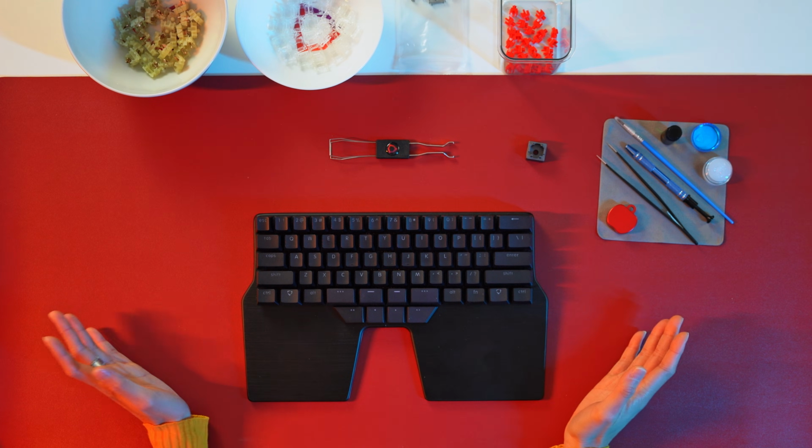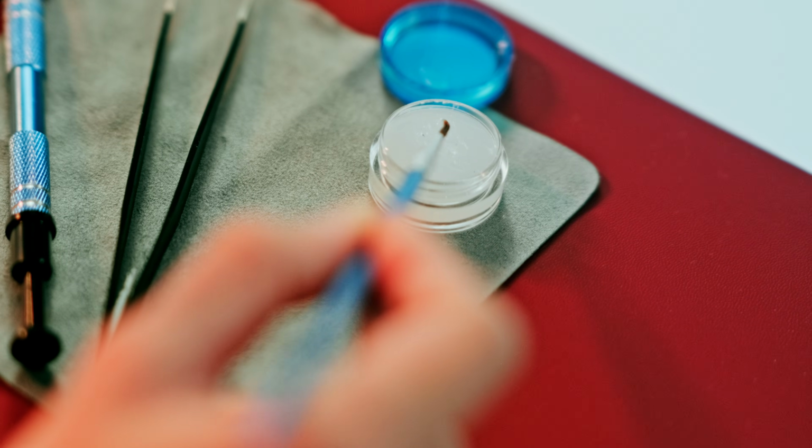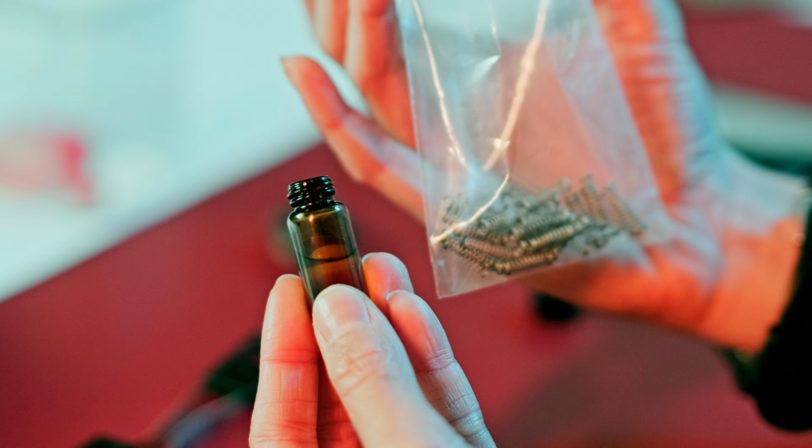First, you have to get the right materials and tools. Since we're lubing electronic components, we can't just use any greasy material sitting around the house. Instead, we'll use dielectric grease. We recommend getting a thicker one for the switch, the most common being Krytox 205, and a thinner one for the spring, like the Krytox 105, which is closer to oil. They are usually sold together. You can find them in your local hardware and electronic stores, but we'll also link them in the description below.